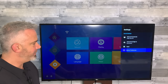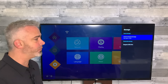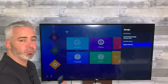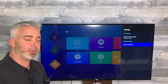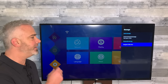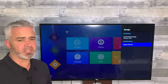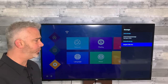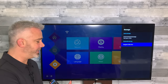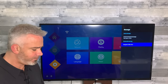If you go to Device Preferences and hit down to Storage — this is a nice thing — even though this unit only has 32 gigabytes, I've added a Seagate two-terabyte drive and just plugged it into the USB port, and boom, I have access to it. I can play from it, move to it, do all kinds of things. It's harder to do on a Fire Stick. You can auto-format it right here once plugged in. For IPTV with a DVR feature where you want to store recordings internally, you may want a 64-gigabyte version, but for most uses the external drive solution works great.